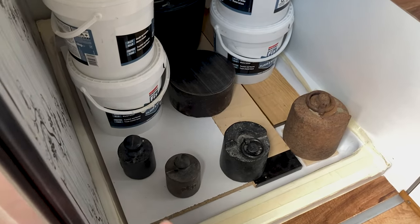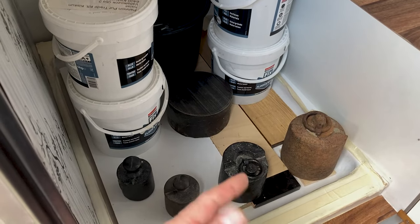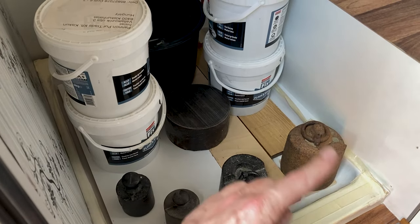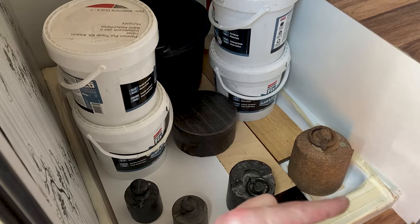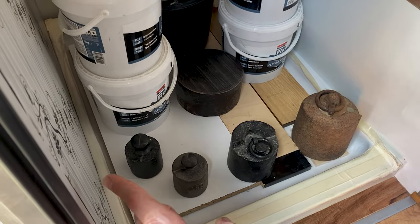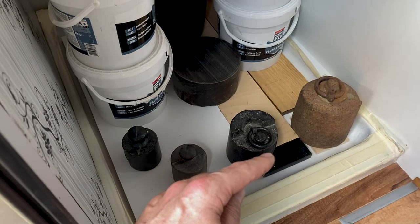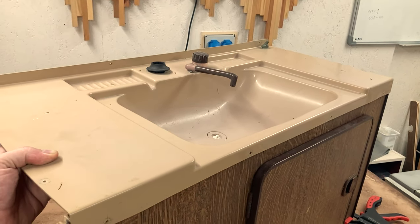Shower pan is in. I forgot to mention that I sanded the underside of the tray and degreased it just to be sure. I leave this for a couple of days and also I sealed the floor with some lacquer, I guess that's it, and caulked all the edges beforehand. And obviously after everything is done, I need to caulk all the corners, edges and everything, but if they fail, there is still a protection underneath that to keep the floor intact. Now that the shower pan is drying, I can do something else.